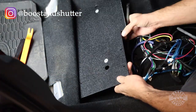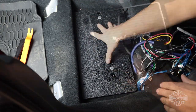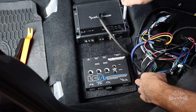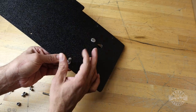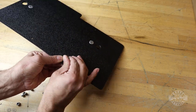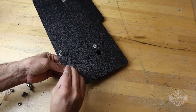Back under the seat, the platform I just made fits like a glove. But before I secure it with the nuts, I'm going to place the components where they will go and then mark the screw positions on each. I already drilled some pilot holes for the screws, but I decided to elevate the line out converter in order to fit cables underneath it since the space under there is tight. That also aids in airflow, which is a bonus.